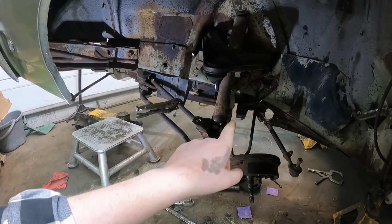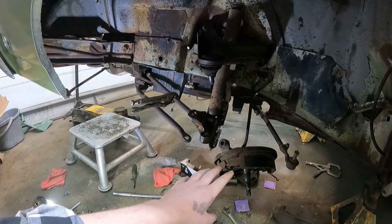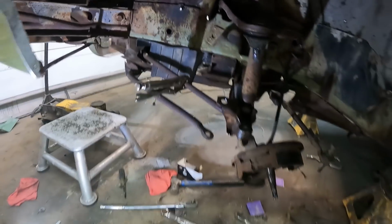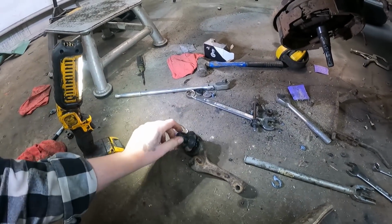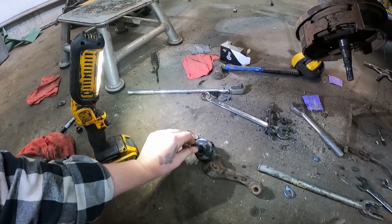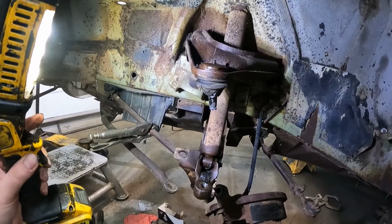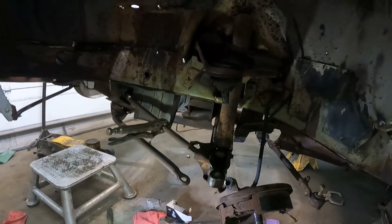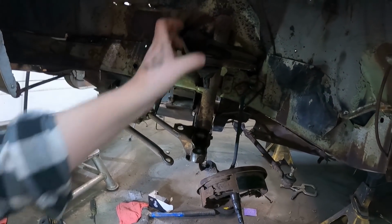You loosen the torsion bar, that's what I did anyways. Loosened it, broke the spindle off, that was easy. Took the lower control, or lower ball joint off. It's kind of cool, just bolts on. This thing is worn out like crazy. The upper ball joint actually threads in, and it's got a 4-point, kind of square, I guess. It needs a special socket to go on there.